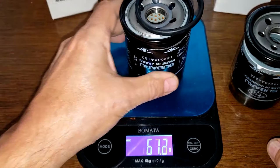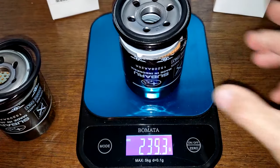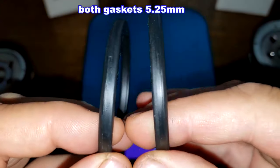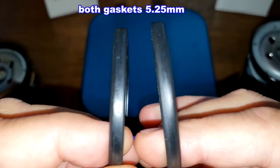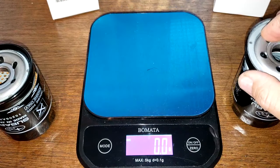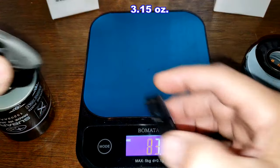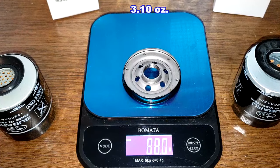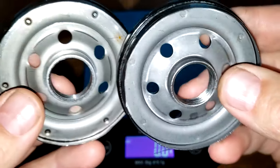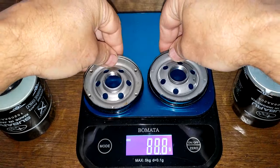Here they are cut open. Made-in-Japan weighs 227.3 grams; Indonesia weighs 232.9 grams. Taking a look at the gaskets — both gaskets are the same thickness. Base plates: Indonesia is 89.2 grams, Japan is 88 grams. These are pretty much the same — same amount of grooves for threads, same inlet holes. Basically the same base plates.